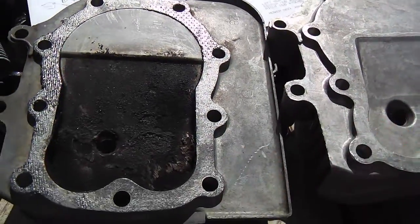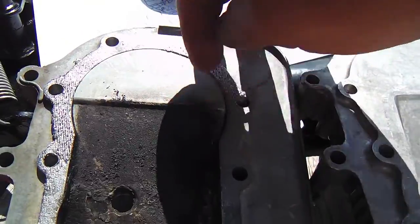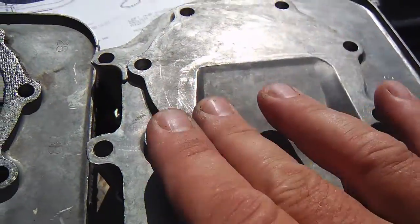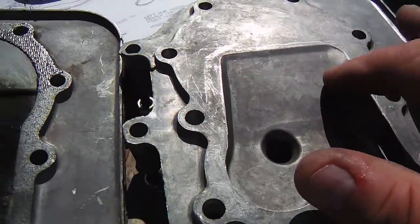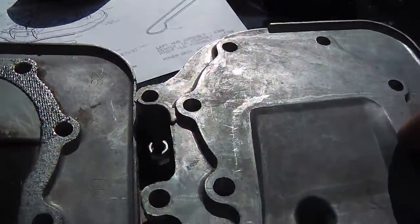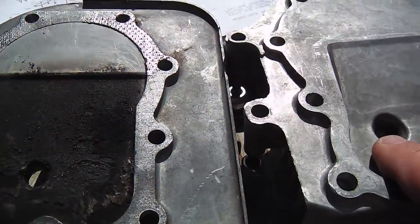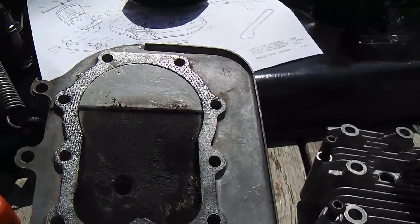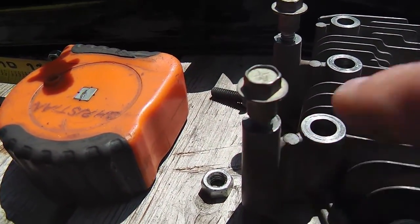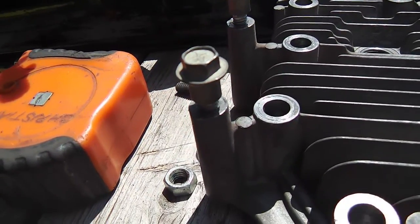But there are some slight modifications that you need to do to make this work. You'll notice that this has a lip on it too. So even though this shows to be obviously flush, this actually has a lip. So it's not just here that you're seeing the volume taken up with the metal. It's also this lip here. It's not here. So there's a little bit of volume under this space. Now, when the gasket goes on there, it'll raise that up a little bit. So that'll be a kind of lip in itself. But this should give me more power. But the modification necessary to pull this off well is that these bungs or bosses stick up at different heights for the cowling and the venting or the ducting.